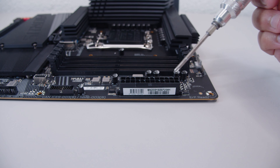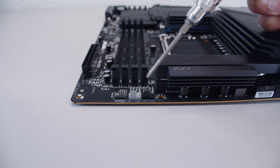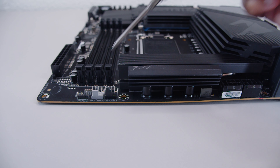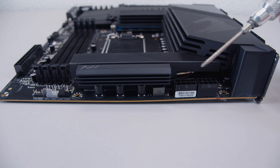There's also another 3-pin 5-volt addressable RGB header and two more PWM fan headers — one for CPU fan and one CPU OPT for liquid cooler pumps and whatnot. And two 8-pin EPS power connectors to send juice to your CPU.